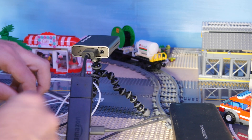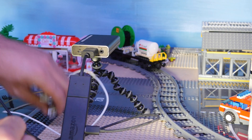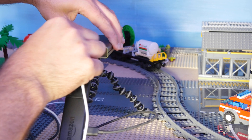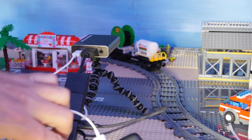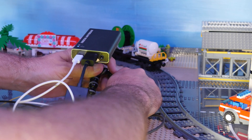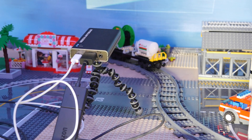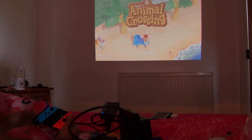On the rear you'll find a 3.5mm audio jack, as well as an HDMI port and the micro USB port for power. Because there is no internal battery, you do need to plug this into some sort of power source to use it. The full-size HDMI port should be compatible with anything you plug in, but if you do have problems, try to make sure you're outputting at the native 720p resolution and 60Hz refresh. I had no problems connecting this to a Nintendo Switch in its docked form or to a Fire TV stick, although I did need a little HDMI extender because the stick conflicted with the micro USB power port. I did have a couple of problems projecting from my MacBook Pro, and I'm not entirely sure why — it could have been the dongle I was using was faulty. For everything else, I haven't had a problem.